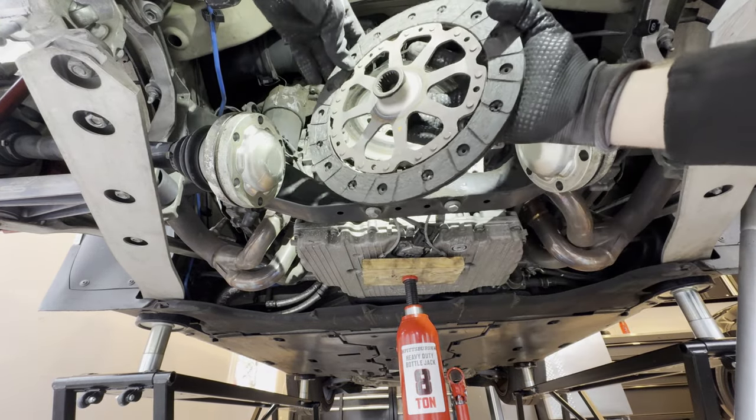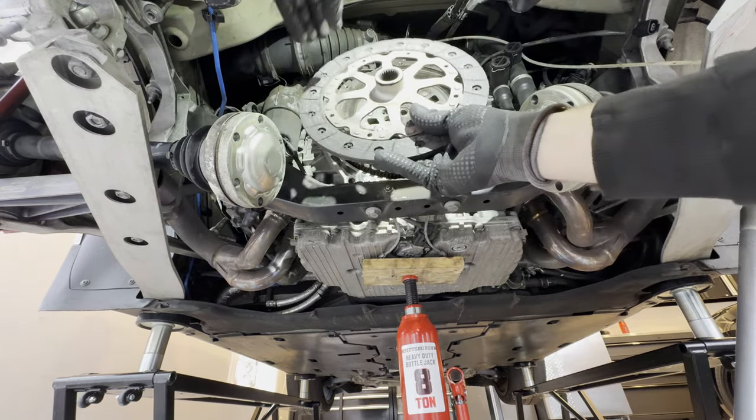This feature on the clutch disc itself is going to be facing away from the flywheel. At this point, inspect for wear. Mine looks pretty worn out, so I'm going to order a new clutch. I definitely would not advise putting this back in. I'll drop wear specs in the description below. Probably get a new pressure plate while I'm at it. Also inspect your release bearing — mine seems pretty wobbly, so we'll order one of those as well.